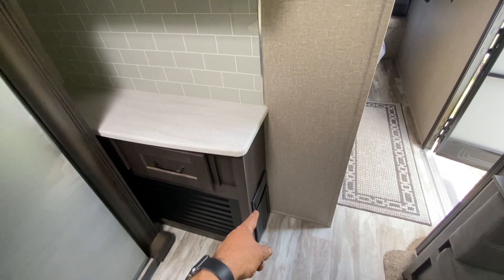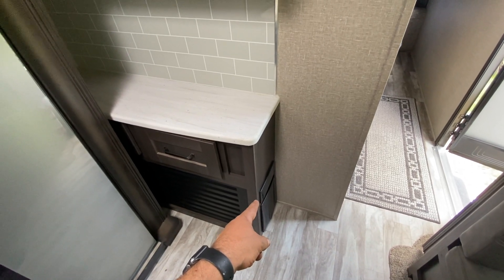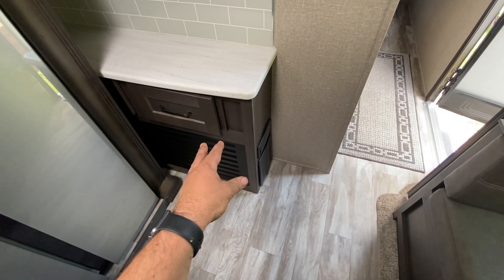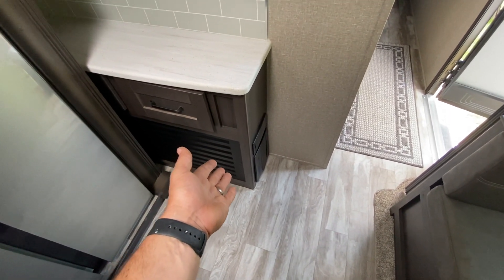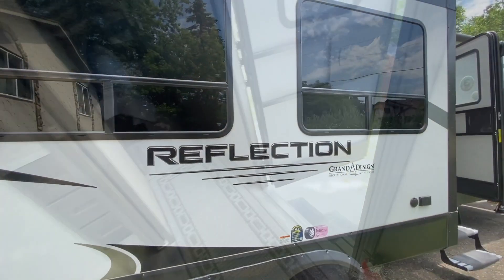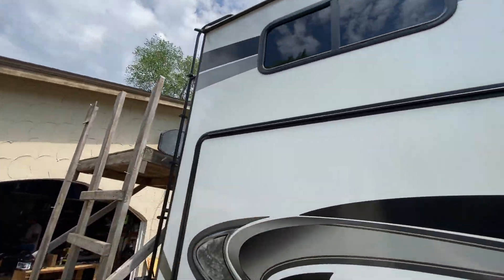We were able to fish-tape the HDMI and USB down here and connect those up to extensions, along with the 6x3 AC cables that we had to rerun all the way to the front bay. These units come with pre-wired 30-amp two-conductor inverter cabling, but we can't use that because the Multiplus is taking over that role. We also disconnected the converter — that's very important. Grand Design Reflection, nice rig.